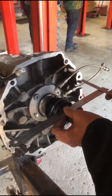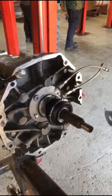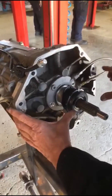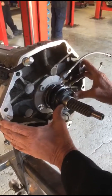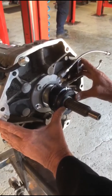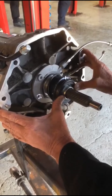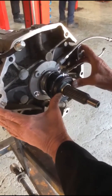At this moment we've got 75mm, so we're going to need about a 13mm spacer to get it just right. Now remember, a concentric slave cylinder, when it's in situ, works in about that position, and through the stroke of the clutch it works like that. The reason for 15mm of crush is so it doesn't jump off the end and destroy the bearing, and furthermore, so it's not fully compressed and wearing out the clutch. So it works in that small area there.